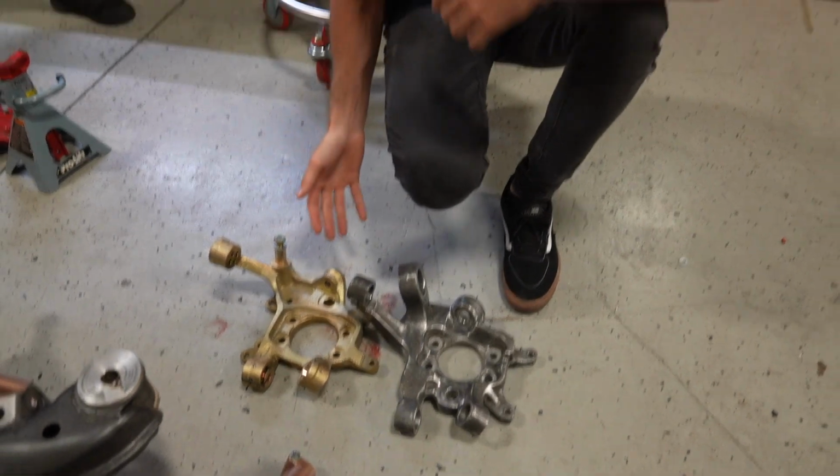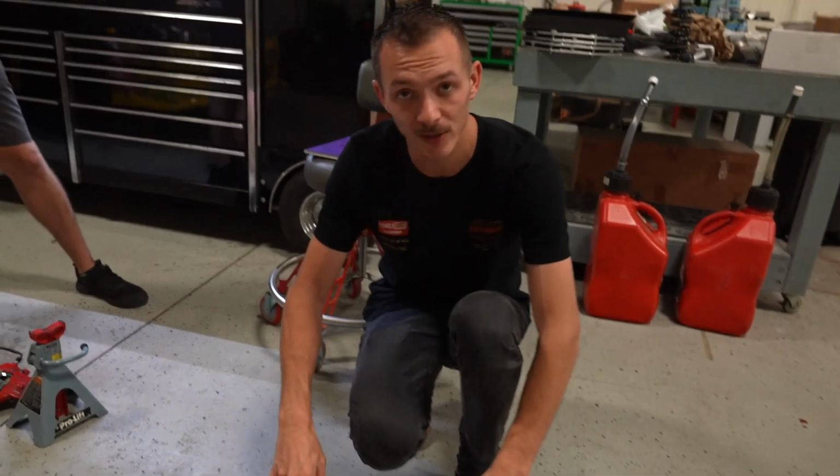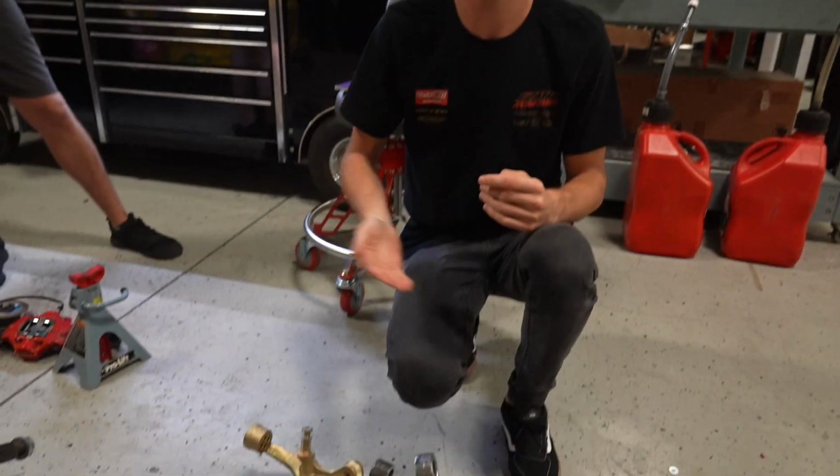And what that allows you to do is to still have all the suspension arms at the optimum angles, but you're able to move the wheels farther up in the wheel well so you can be lower without ruining the geometry of the car and having your arms flat or even pointed upwards. Because we're at stock height and we add a drop knuckle to it, it's almost like if we took a stock 240 and lifted it. So most of the way the suspension is designed does not work the way it's supposed to. We have really steep angles on the arms, and that affects a lot of different things. And I'm going to let Freddie fill you in from here.